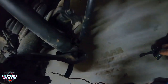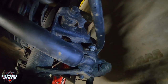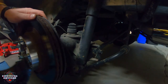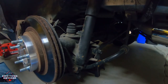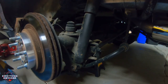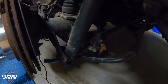As you can see right here, this nut is blocked by what I believe is a sway bar - some type of sway bar linkage. The nut is not going to come out. So what I'm going to do is grab a jack stand, just because I don't have a block of wood big enough. I'm going to place the jack stand on something solid here, put the jack there, and check the car up a little bit. Be sure to move your other jack out of the way before you lower your car, and take it real slow just to be safe.